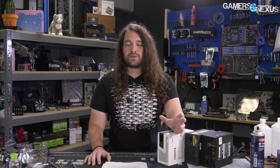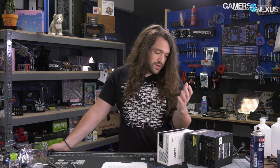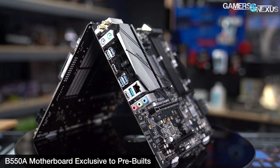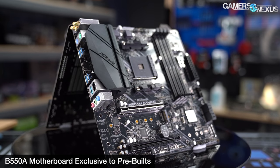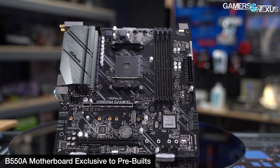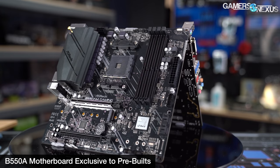These regulations are built to apply to prebuilt systems, not necessarily for DIY enthusiast systems—that's the first thing we need to set straight. A lot of people think that all of their power supplies are suddenly going to drop to 12 volts, and that's not necessarily the case, at least not in the immediate future. A lot of pre-builds, especially from traditional OEMs, use motherboards that can't be bought retail, meaning they have the ability to move some of the 5V or 3.3V conversion onto the motherboard, whereas DIY enthusiasts just don't have the physical real estate to support it.